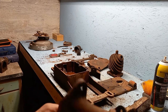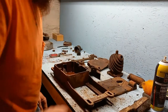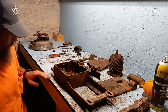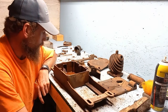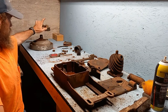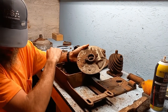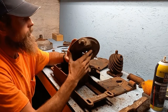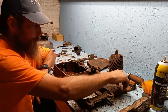They've done a fair job of it, but I've got a better one off of a parts engine. I bought another one of these a few months ago and tore it down with the intention of overhauling and restoring it. When I got it home and tore it apart, the magneto was broken here and here — this whole clamp was broken off of it — and there were a few other things that were in pretty bad shape.